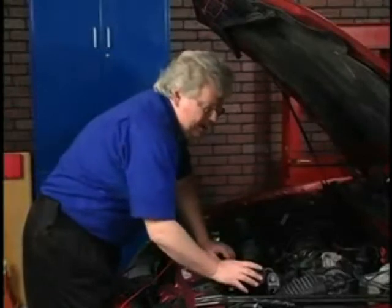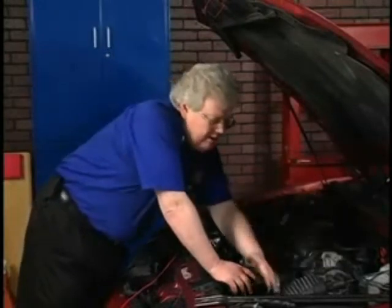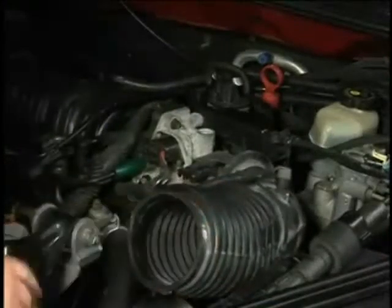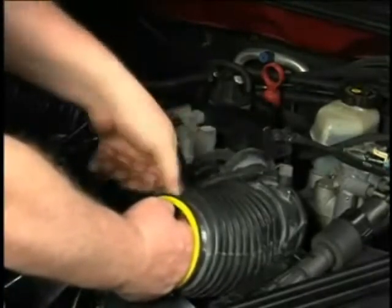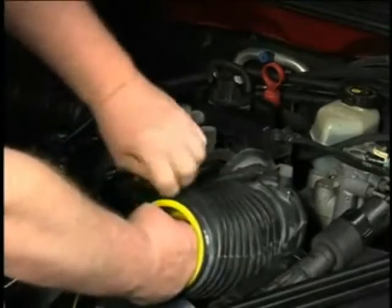The first thing I want to do is block off where any air could get out of the intake system. We know where it can get in, but where can it get out? It can get out right here through the feed from the air cleaner to the throttle body. We'll take that off the air cleaner and use a little plastic insert that comes with the machine and the kits. Crank that down — I love the hose clamps with little levers on here, very handy. That should block that off.